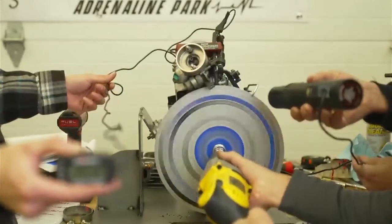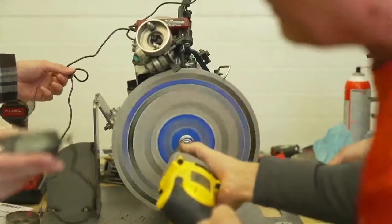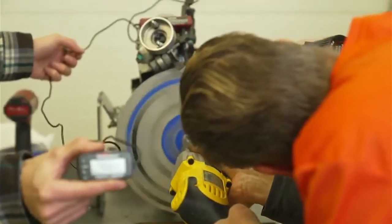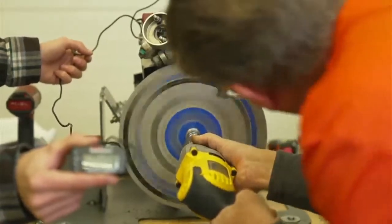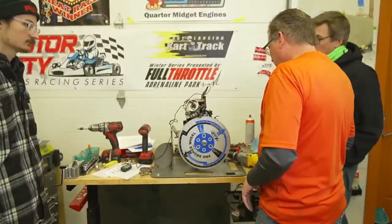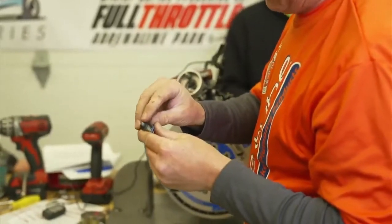And now it almost is at 28. Before, it was 27 3/4. So we picked up 0.25 just by the spark plug. One spark plug. Okay, now let's try and slow it down. And that's about a half a degree right there. And it's so hard to hold this at 2,000, and then look at the thing and then look back at that. You can see, we have three people here just to check timing. So the Brisk plug is worth 0.25 in timing at least. Right, and that's why you're all running this Brisk plug. The Brisk plug sparks from the end of here to the electrode, and it's a hotter burning plug.